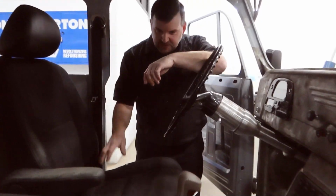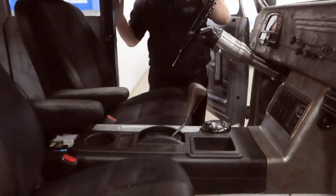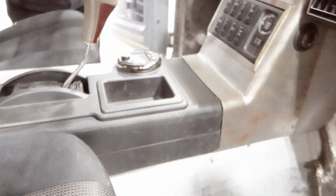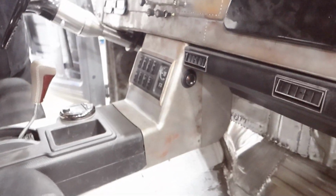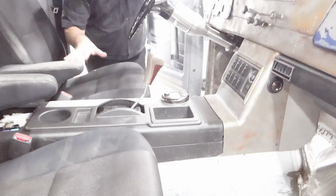Well, we managed to fit, since the FJ doesn't have any channels or any way to pass any electrical through the outside, everything had to go down the center console. So in the center console is the entire Lexus harness, minimized down to BCM and ECM and drivetrain fuse box and original fuse box, everything down inside there, and underneath the seats being some of the other modules. So yeah, you can't see, it's just a box now.